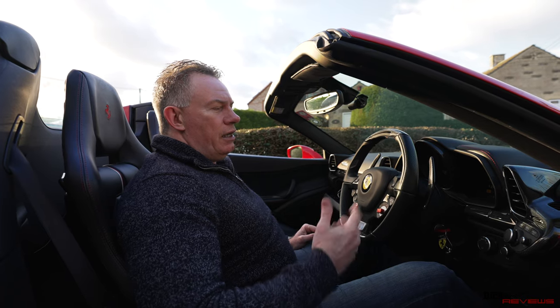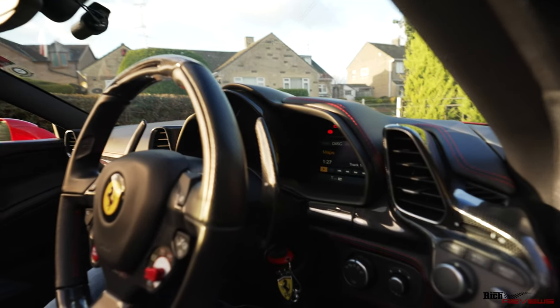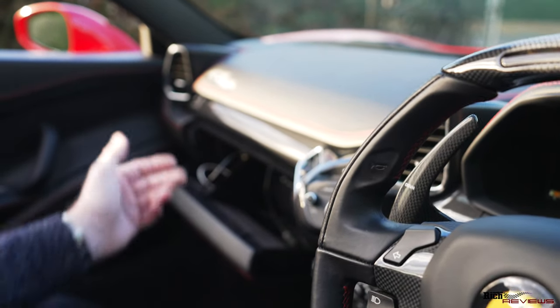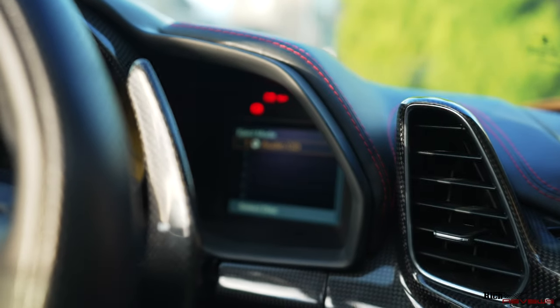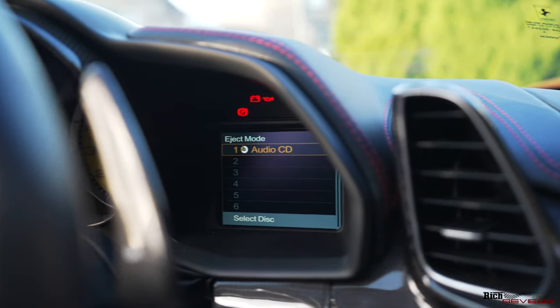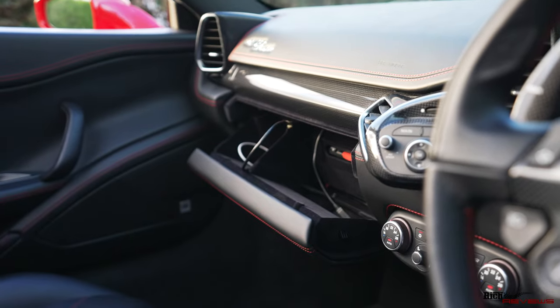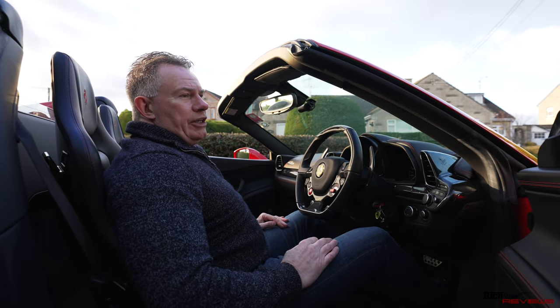Now I'm going to show you how you would eject a disc. So you're thinking: I'm in the disc system, I want to get that disc out — how the hell do I eject it? You go to the multi-changer, press eject, and then it comes up with the list of drive bays. It will time out, so if it times out you have to press eject again, choose the bay, and it will then eject the disc from the multi-changer. How crazy is that?